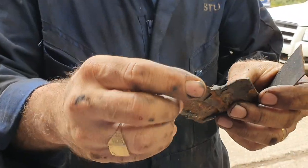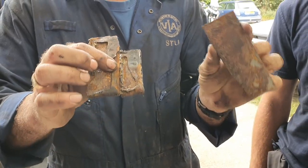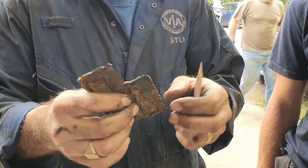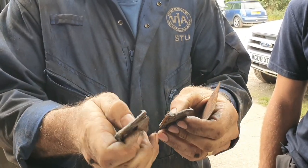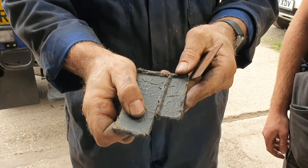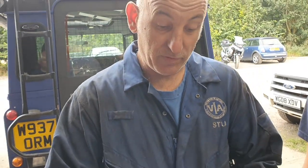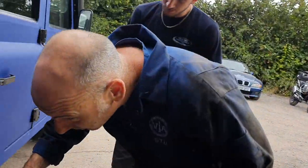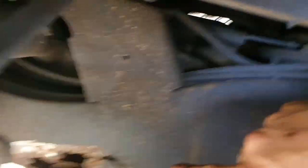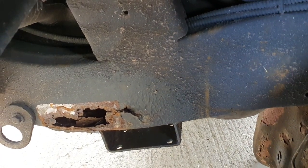So this is one way how not to repair a chassis. These are patches of metal that have been glued onto the chassis — and when I say glued, they've used mastic to stick it over the hole to make it look like it's had a weld. As you can see, that looks like a weld, and then they've just put wax all over the top of it. I've literally pulled that off the chassis with my hands. And the result — you can see the hole there. It's starting to creep further towards the front, and it's even worse on the other side.